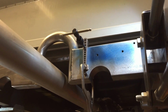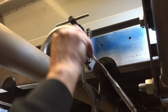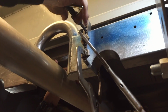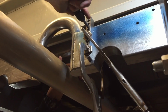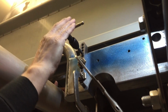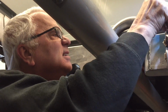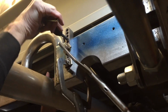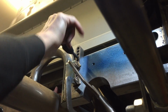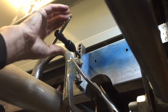and then I'm going to clamp it again just so that it doesn't move. And then we're going to go ahead and tap the hole. This way, I know the hole is going to be perfectly straight with the frame. It's really hard to, you know, usually when you're tapping this stuff, you're eyeballing it this way, and then you get underneath and eyeballing it this way, and this little tool really takes the frustration out of it. They're not very expensive, and they're really handy. So back and forth, so you clean the chips out of the threads.